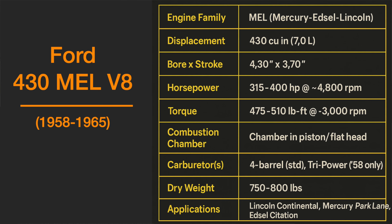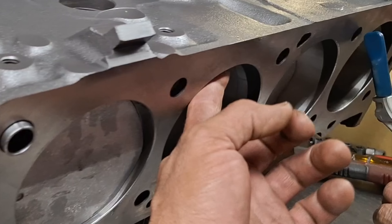I'm excited to see how that's put together because it's pretty tricky. It's kind of like a wedge-shaped, angled cylinder head. The top of the head where the valves are is all flat, like a diesel engine, and the pistons have a really odd shape to them. There's a cavity just inside the cylinder area that's not part of the moving part of the cylinder. It's just very different, and they're a little bit difficult to assemble.